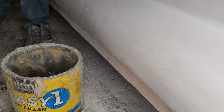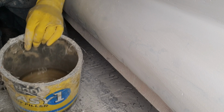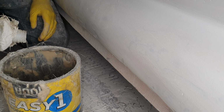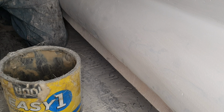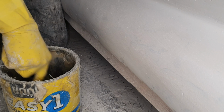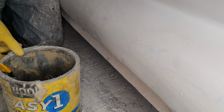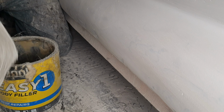Okay. Right. So I've got a small amount of resin in there, not a huge amount at all, as I say. So basically it just means a tiny bit of activator that will cover it. Put that over there. Give that a good stir. That's basically all you need to do, just that little bit to get it activated around the place. Now it sets, or goes off, should we say, pretty quickly. So you have to be a bit fast with this sort of stuff.